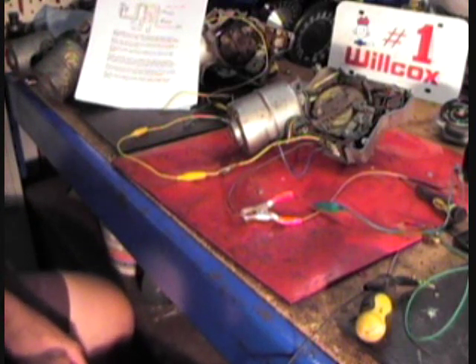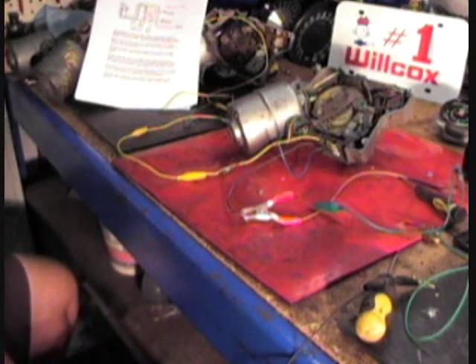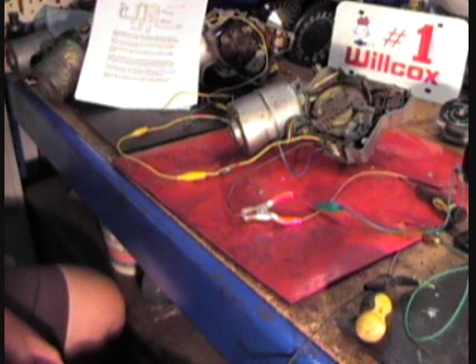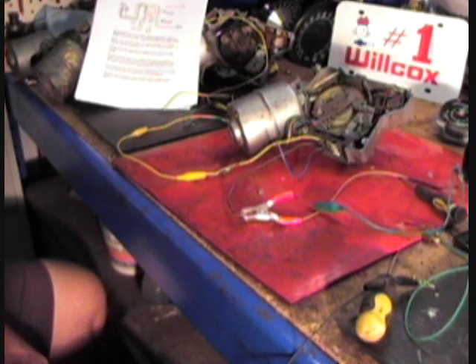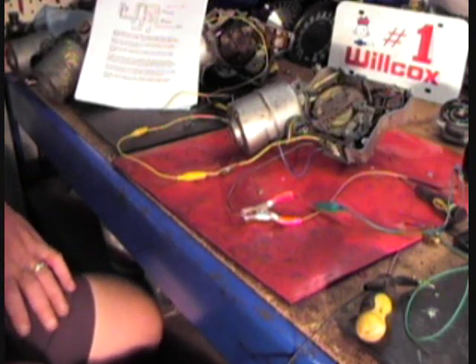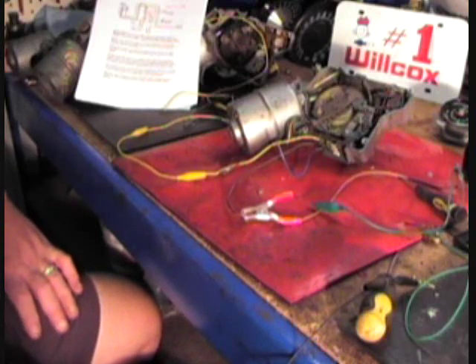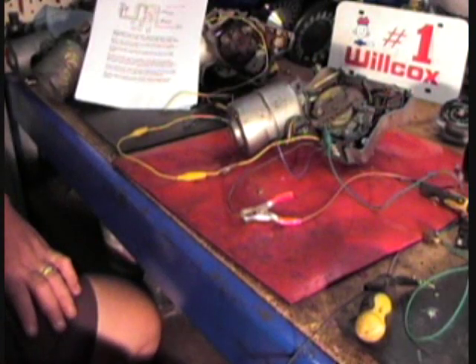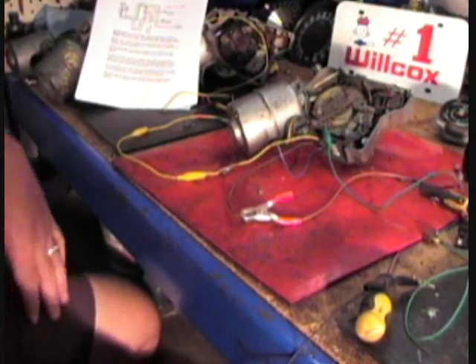Hopefully you can see what the motor does in each situation so you can tell where the problem is. The wiper switch has the yellow wire, dark blue wire, and blue wire running to it — all three of those wires are grounds. The wiper switch has to be grounded; if it's not grounded, the system will fail. So make sure your wiper switch is grounded and make sure your wiper motor is grounded. There's a test on the help and repair section that will show you how to do it. With this test motor we're going to put a ground on the case, grabbing it right here on this little copper lead that runs out of the motor. Make sure that's clean and grounded as well.